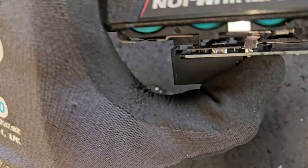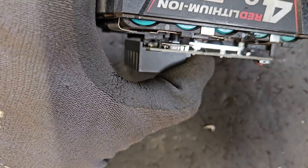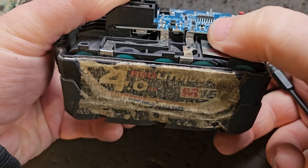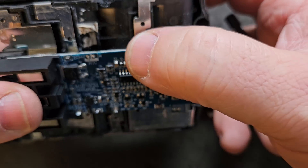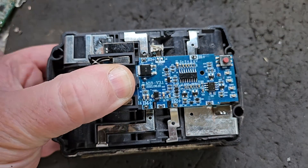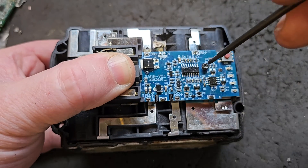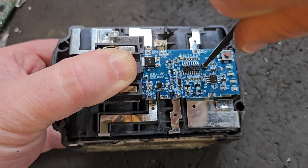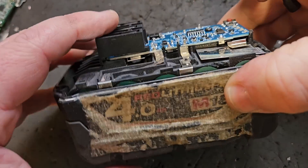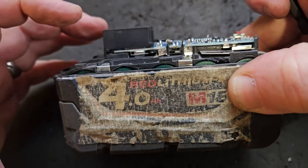And this bottom one here. So with all your connections through the board like that — up through — hold it in position like that, and put on the two T8 screws that you might remember from the last episode. There's a short screw goes on here; tighten that down so it doesn't spring off again. You have to line those up — there are actually two slots that go on there that click into the top of the battery.